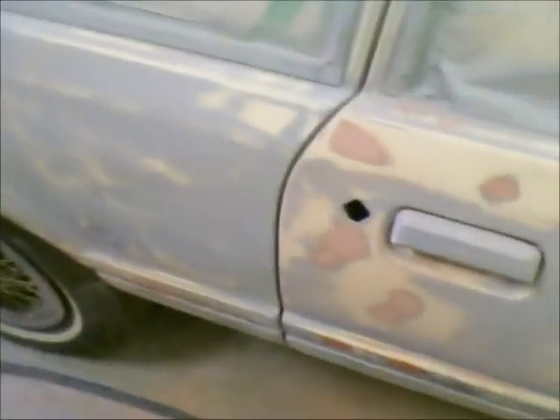Went around the whole car after I glazed it, sanded all the glazing putty and stuff down. Addressed a few more little low spots where I hadn't gotten enough putty on it. Everything's looking pretty flat now. I'm going to sand the last couple of little places where I had to add some putty to it and I'm going to reprime it into all areas. Everything seemed to be working out pretty good coming along so far.